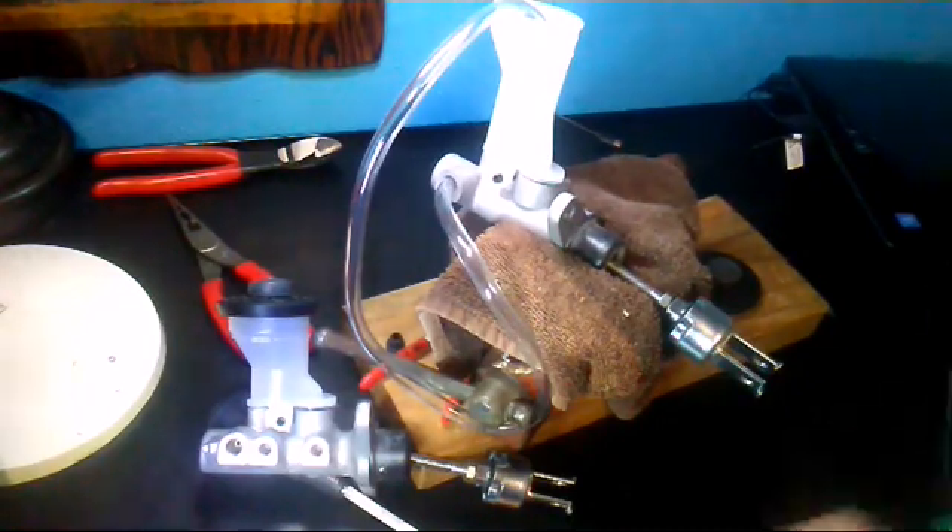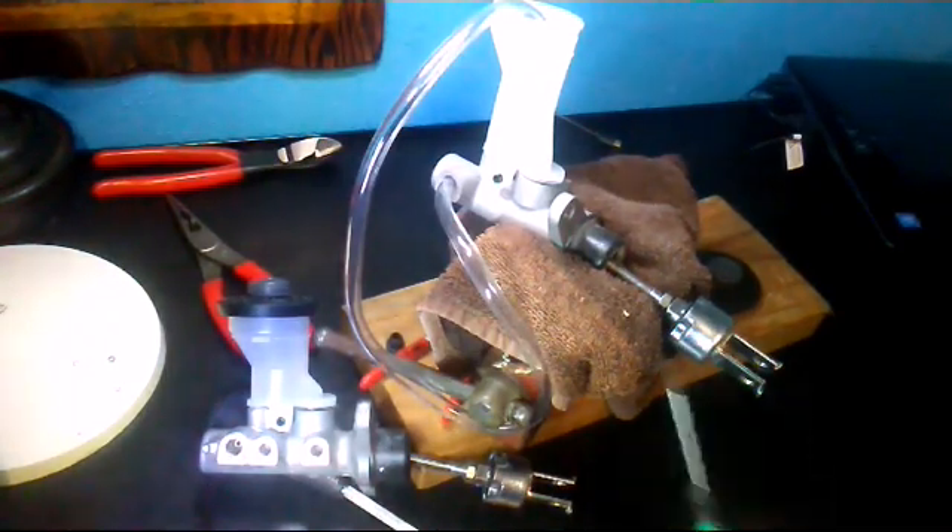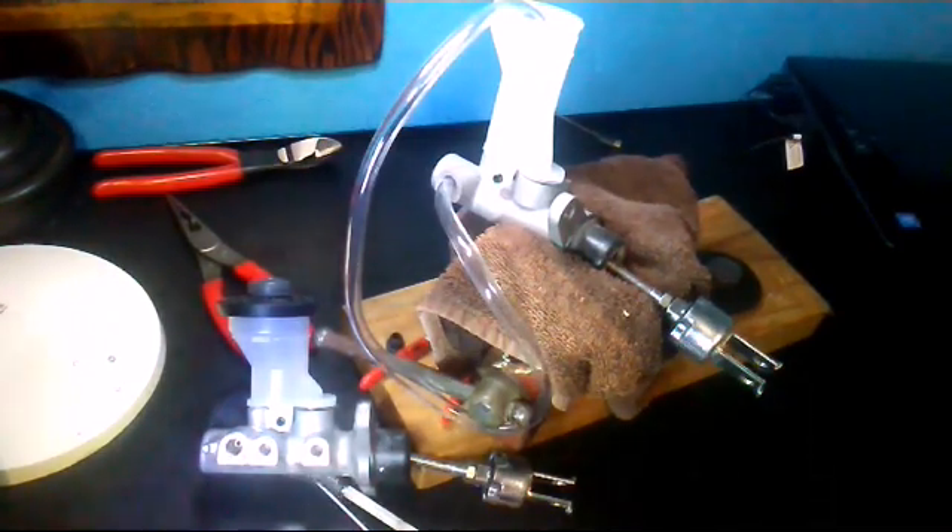They look very similar, but that's the difference. Another thing on Toyotas: if you order it for the V6, you can get the one-inch bore, and that's going to be an upgrade master cylinder for better stopping power. You don't really want the smaller one if you have four-wheel drive and plan on putting bigger tires — you want to get the one-inch full-size.